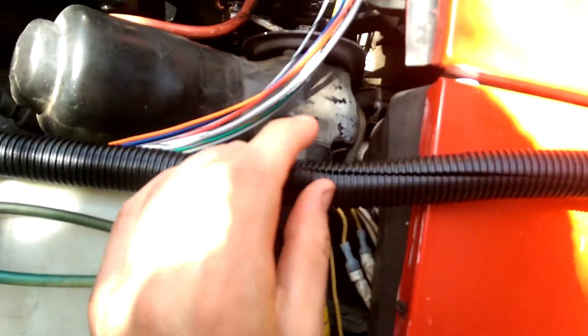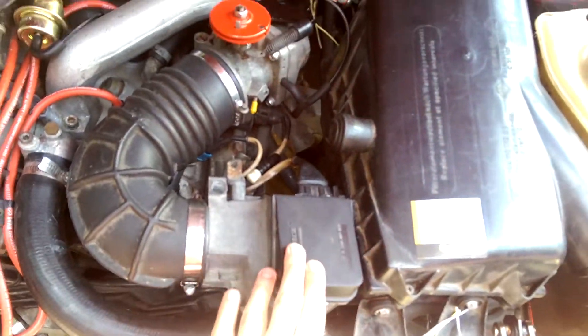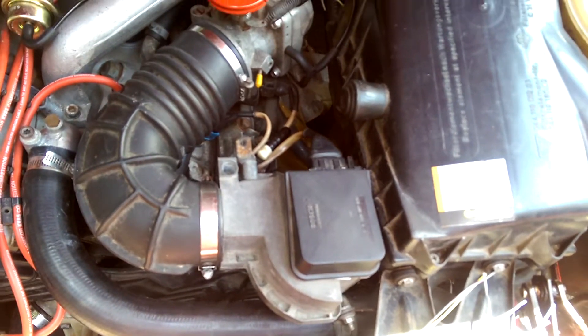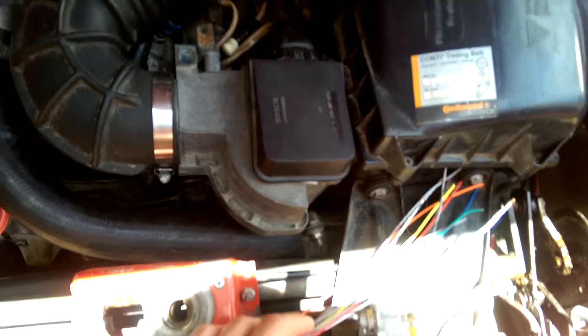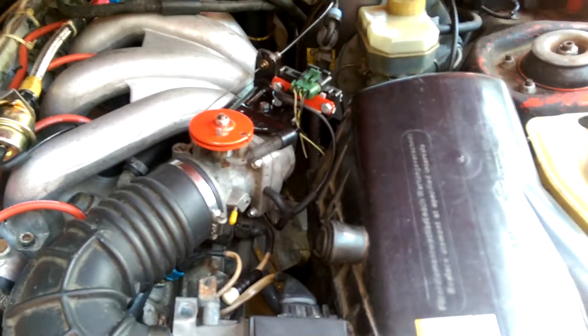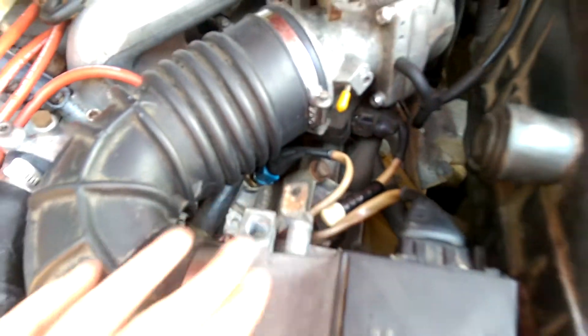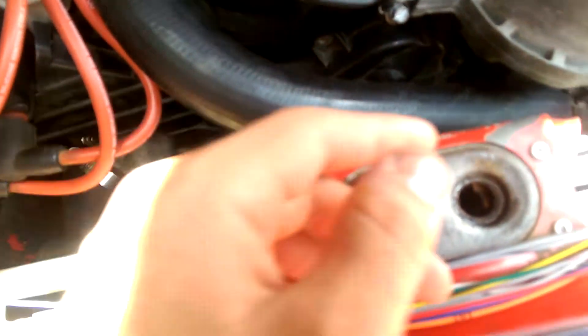I still have this conduit, which is too big at this point, but these are the rest of the wires and these are all just for the sensors. The AFM won't be here, but in its place there will be an intake air temperature sensor, which a couple of these go to. The TPS — I have a 951 throttle body position sensor which will live down there and I have a connector for that. The MAP sensor — I was mocking up connectors for that. Coolant temp — I'm using the DME's temperature sensor to give a coolant temperature reading to Microsquirt. And then the hall effect sensor, which reads the trigger wheel, and that'll send a reading back through the opto-in.